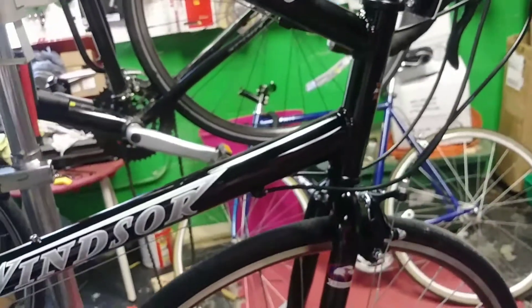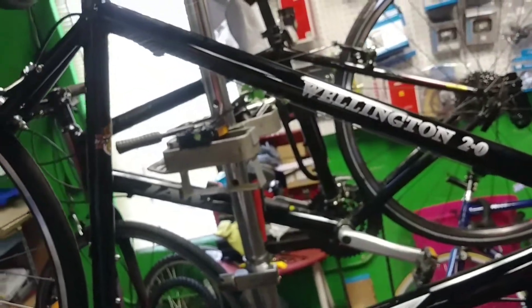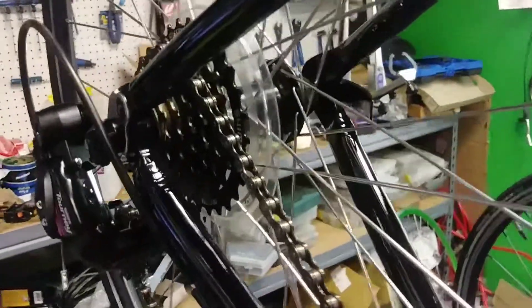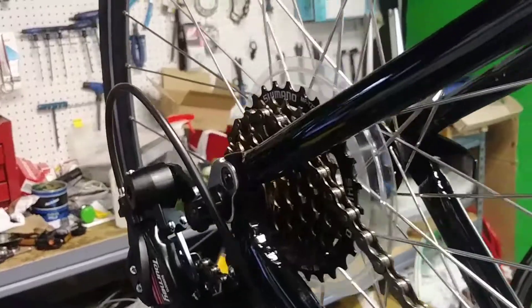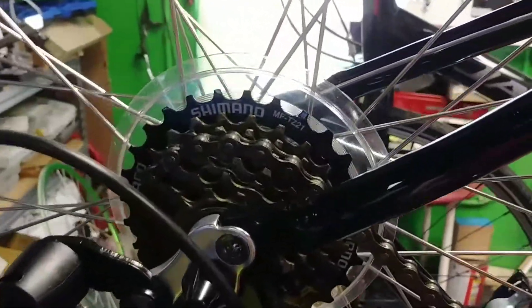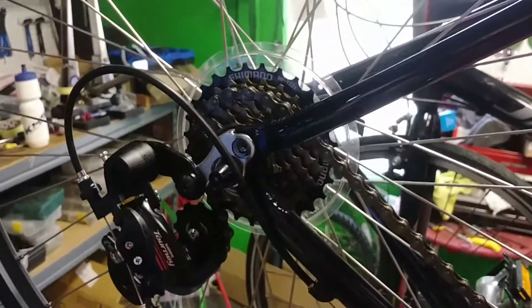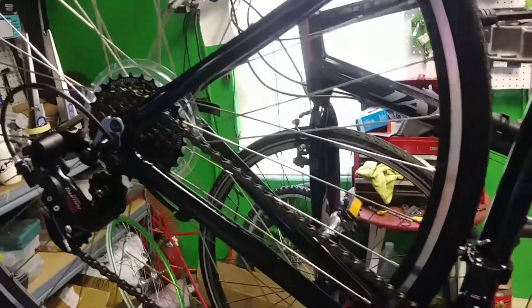This is really designed to be your first bike to get into the sport without dropping a whole lot of cash. The only other area where they kind of cheaped out is that they used a freewheel here instead of a cassette. It's just a different style of gear cluster. It will make the rear wheel a little more prone to bent axles, but other than that it's pretty good.